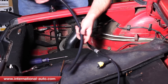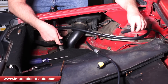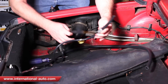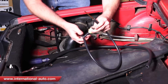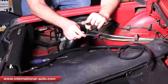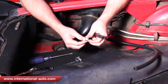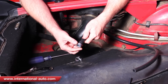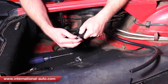We've made our hoses up. This was pretty simple — it was just a straight hose, cut to the same length. I'm going to route it the same way the original one was and put a clamp back like the original. This one was a little more work — had to put the valves on it and the fittings. When we put this back together you have to make sure that it stays upright — you can't have it leaning over; it has to be properly upright. We're going to use the clamps that we sell here at International Auto — the edges are rolled over and they're not sharp like regular clamps, so they won't cut the hose. It's probably best to install the clamp before you put the hose on; it makes it a little bit easier.